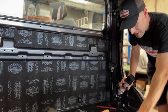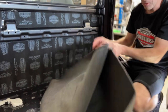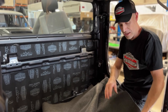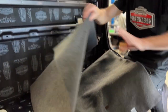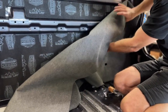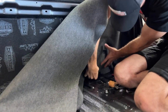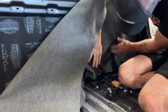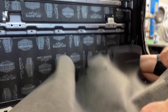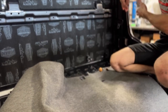What I've already done is pre-cut some tricky holes on these Land Cruisers, which are just around the jack point. In our pack, we do a pack for these cars — it comes pre-cut, as you can see. So this is the pre-cut piece. I'm going to datum this down here around the jack location, just doing a quick test fit to have a look at it. I know it's going to sit around this pretty good. The bottom squares are where I'm going to start it — I'm going to spray that area and this area, pin it on there, and then work across.